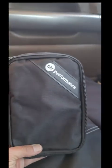So guys, if you're out there over the road, especially with these newer trucks that have all these after treatment issues, make sure you get this OTR Performance. $600 for the year, but for a couple uses, this thing pays for itself. It will force a regen, it will reset the code, and if you're having derate issues, it'll turn that off so you can get to the next spot.